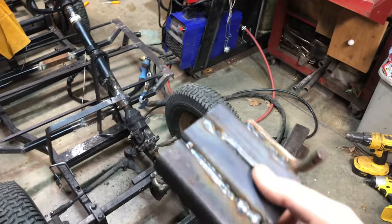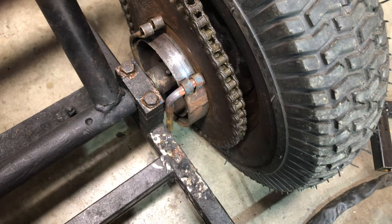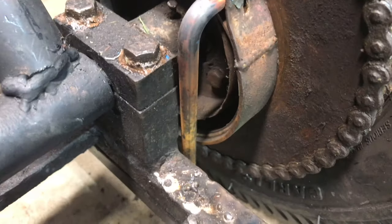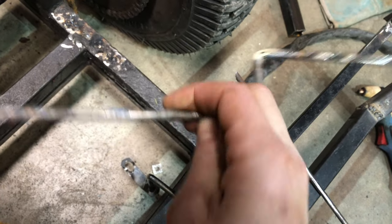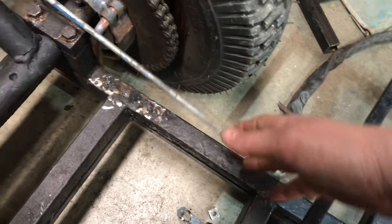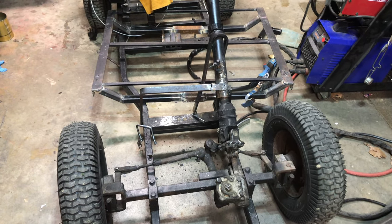This is what dad had welded up that sits inside that little brake right here. He had welded this to there and I'm going to drop that piece down and just weld it to the bottom side of this axle tower here. I think that'll work just fine. The brake going up to the front of the car is this piece here, and I wanted to run it under the floor — he had it on top of the floor. So I put two 90s in it so it'll drop under the floor, up to the pedal. I got to patch up what I cut apart up here and fix that all back up nice and pretty.